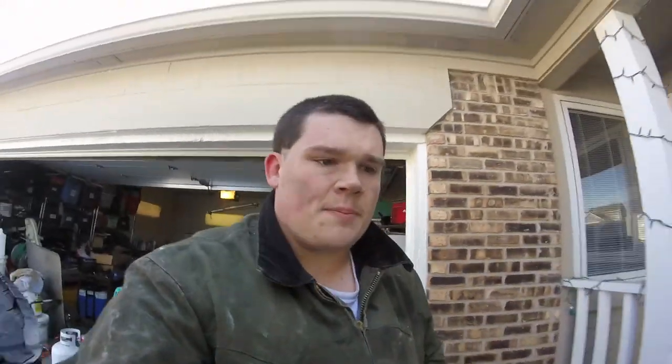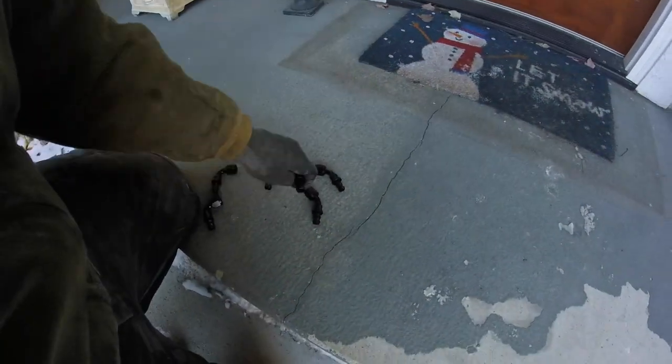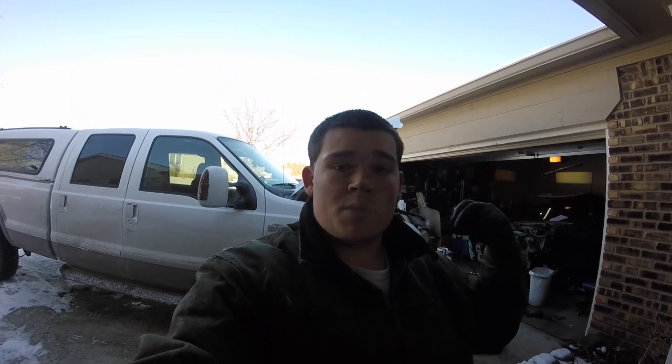Now I've got those on. I've got four 90s and two 45s — I overbought just because I really need to have the truck running by Monday. It's now Saturday and the fitting stores are closed Saturday and Sunday, so preferably I'll have this running by tonight. These are just dash-eight fittings, pretty common half-inch line — what I use for my fuel line, transmission lines, and a few other things. I'm going to take this 90 and this 45 and screw them onto the fitting coming off the filter, since that's the one I'm most concerned with clearance-wise.